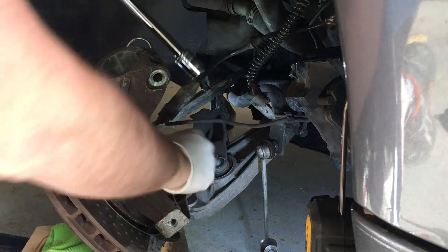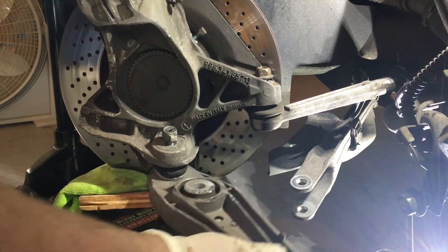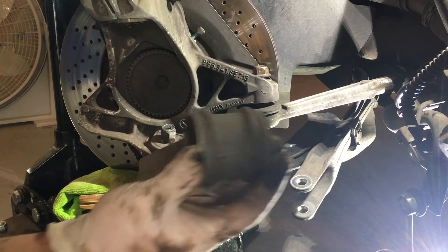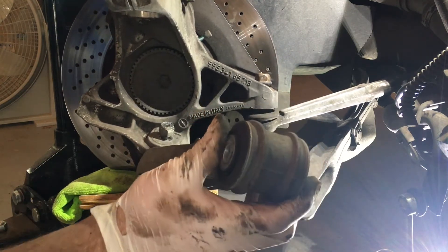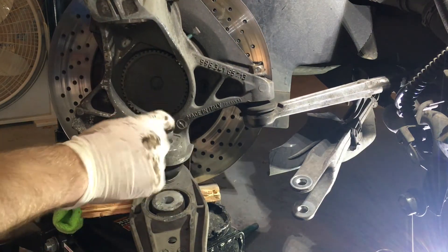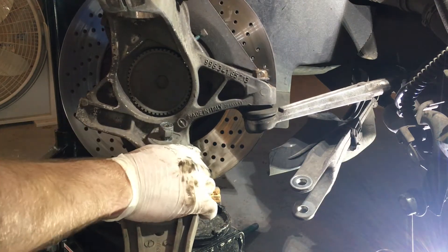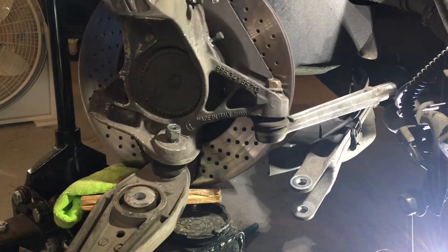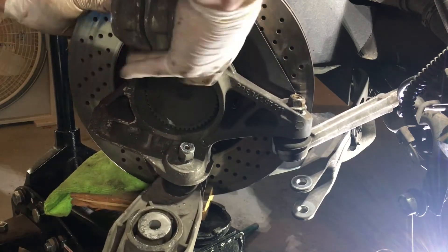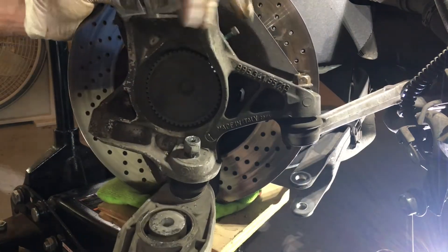I really had to do some work to get it to go. I could not get this ball joint out of there, so I took the control arm off the back and I'm going to try to get some leverage on it and hammer it from this side, maybe get that pickle fork in there and get it separated, or at the very least get some heat on it. We are definitely not doing so well yet this morning as far as speed goes.